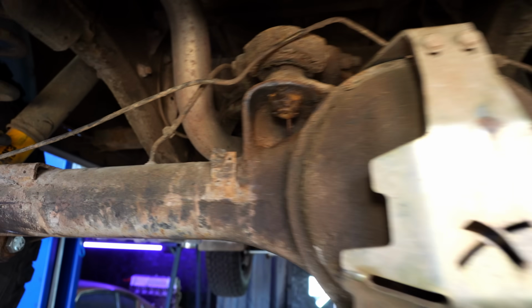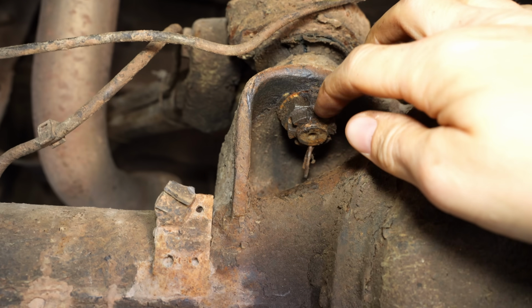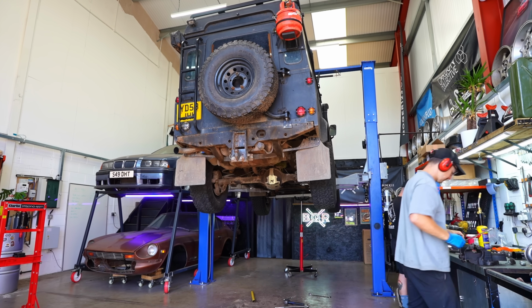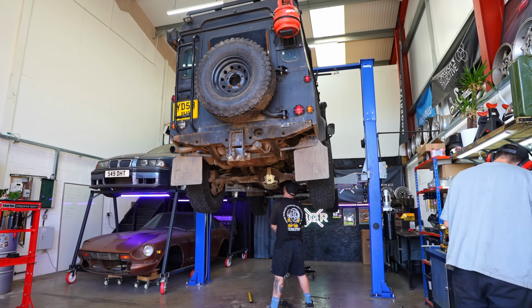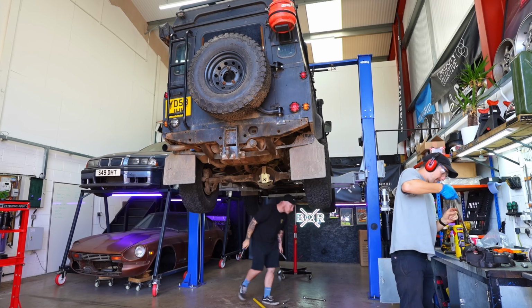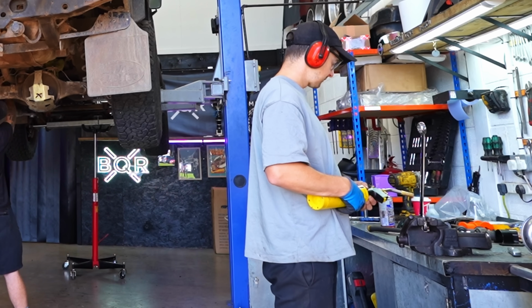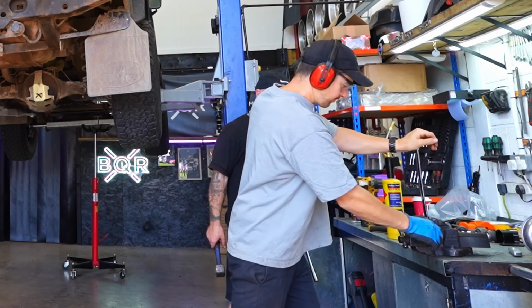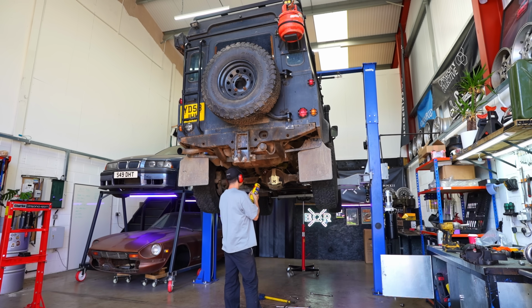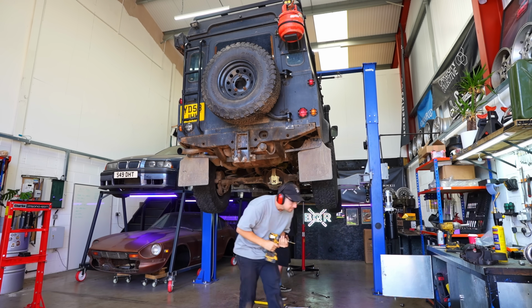It's going to keep going with the back bolts. I'm going to start trying to attack this one, this 30 mil. Today is just challenging us. The spanner I just bought to fit on here, the 30 mil, doesn't actually fit because the fuel tank is in the way and the way the spanner kicks up, it doesn't work. So you can see here, I'm heating up the spanner and trying to bend it to make it fit. But even then, I couldn't get onto it and get it properly undone. So in the end, I just tried to drill it out.